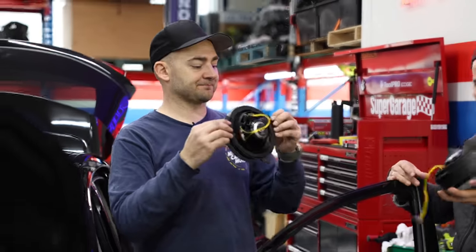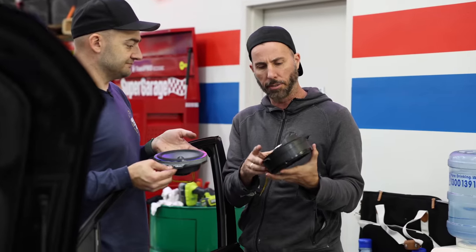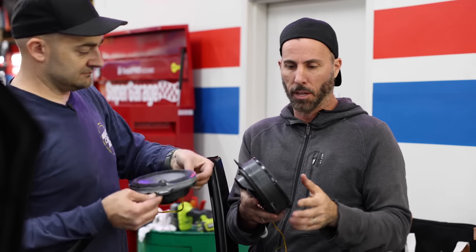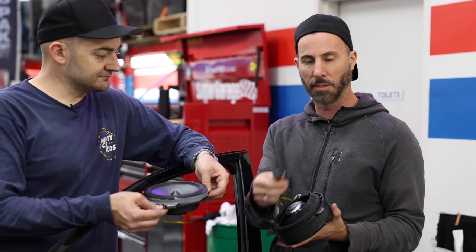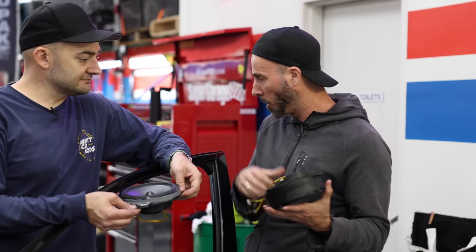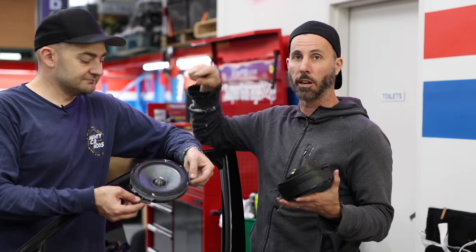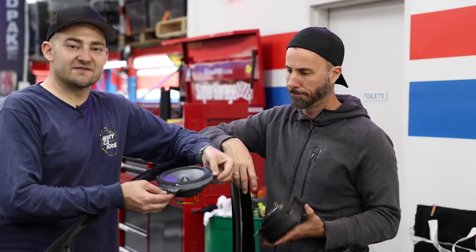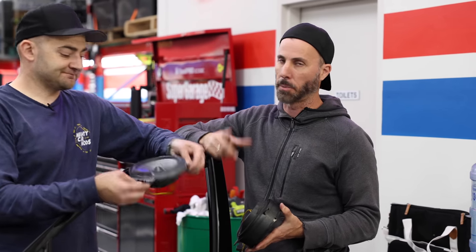Meanwhile, on the back, it's the same kind of thing, but a slightly different configuration. So mine, I don't think needs to be cut down. I've done a test fit just to make sure that it actually goes into the cavity with the door cards over the top of it, and it appears to have maybe 5 to 10 mil of space in between. Same thing, I've cut off the factory plug and just soldered it on here. We don't know exactly what the wiring diagram is for the speakers, but we know there's green going to each side and green going to the front, so we assume that is the ground, and we've wired this up as such. And with speakers, if you get it backwards, the worst is they're out of phase, and it just means it sounds like crap, so you can fix it later. Yeah, and flip it at the front, basically.